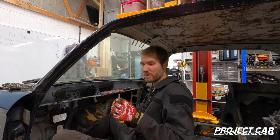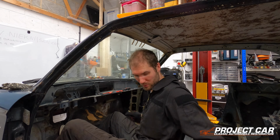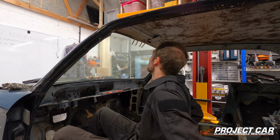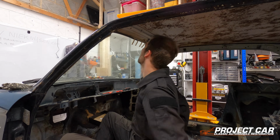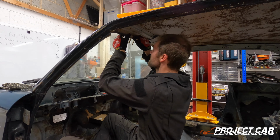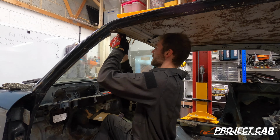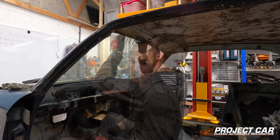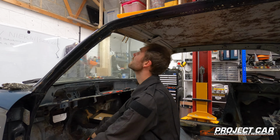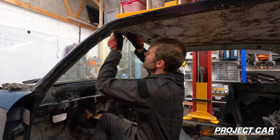Once I've got a little bit of it, I use the other end of it, the thicker bit, to push the rubber in between the pegs, basically push it over the body edge, and then you can actually carefully pull out the pegs you've just used and pop them back in slightly further down the line. In all honesty, I don't know how this affects your rubber. So far it doesn't seem to be that affected by it.